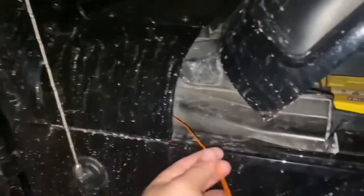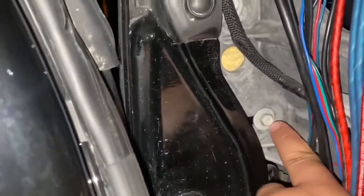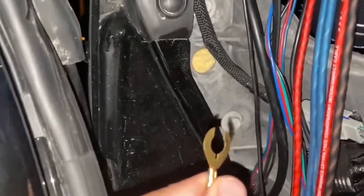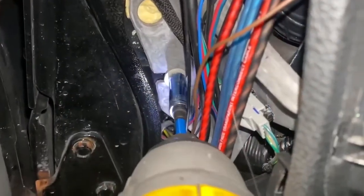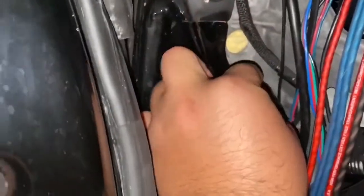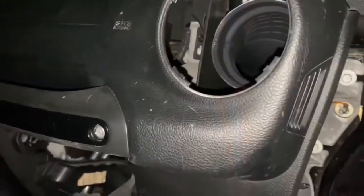Now I'm going to work on the ground and save the power for last. These other wires are for my subs and speaker lights. For the ground I'm going to use this chassis point right here — it's going to be a 10 millimeter. Pull that out, connect your ground, and then we'll move to the power. Grab your 10 millimeter socket, screw it in nice and snug.